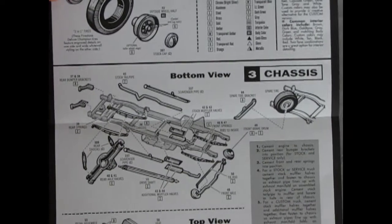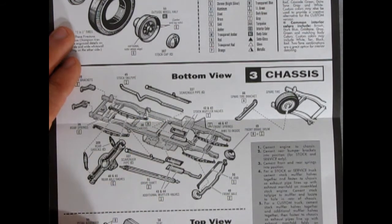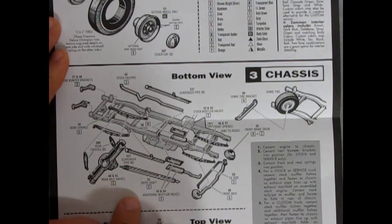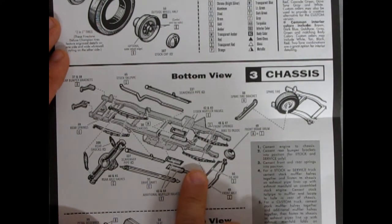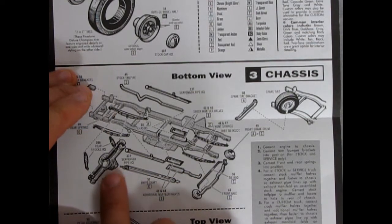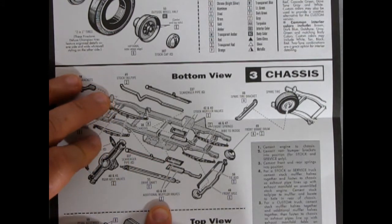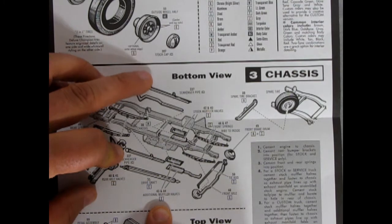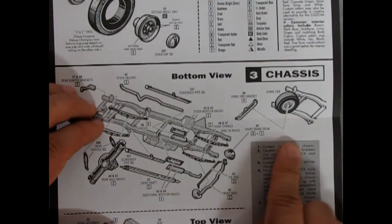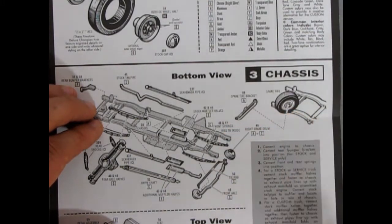And now we're looking at the frame here. The amazing Ford frame, really tough and durable. You can see the high side rails. Anyway, so you get rear bumper brackets on here, which you can omit for the custom version, because that has rolled pans. You have a front axle and tie rods, front and rear leaf springs. The rear ones have the higher buttons on them, which will drop into your rear axle through some holes. There's your rear shock absorbers going on there, your drive shaft. You get these additional mufflers for a custom version. And then, of course, you can use these scavenger pipes. And there's our bent up stock tailpipe that goes up and around the rear axle. Here we have our spare tire mounting on the back with the spare tire bracket, which goes into the hole and over our wheel assembly.